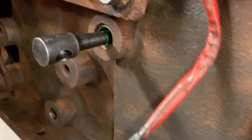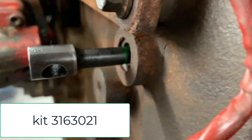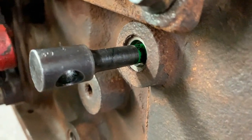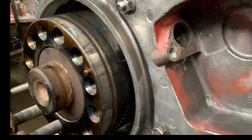There's a threaded O-ring plug in the hole where you see the timing pin — that's a Cummins part and it has a part number. Notice the green stripe is just inside of the block; that's how it has to be to be installed correctly. If you draw an imaginary line through the center of the crankshaft and through this dowel pin, you can see that it goes just about through the center of the hole where the crank pickup sensor goes. So if you get your dowel pin very close to that, you're right there.